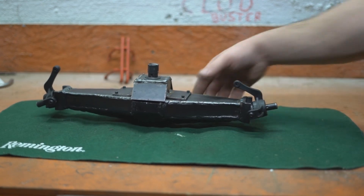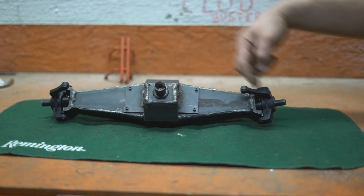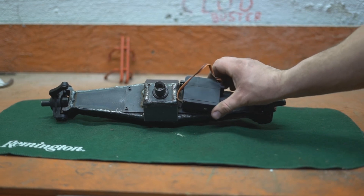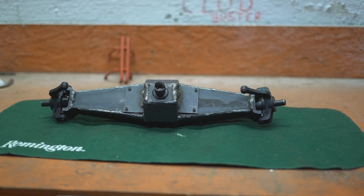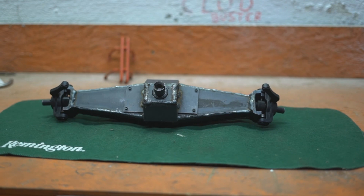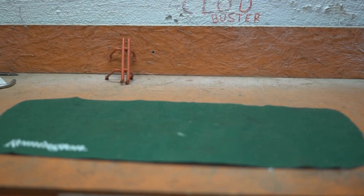The outers are in, the axle shafts are in — that's pretty much it. But I still have to make the steering linkage going from there to there, and also I'm going to make a servo mount. The servo's going to mount right in here — I want it to be behind the axle so that way it's out of harm's way. That'll be pretty easy compared to all this; mounting the servo is a piece of cake. I also have to make another one identical to this because this truck's going to be four-wheel steering. I already have all the pieces cut and machined out for the next axle, so we'll take a look at those.